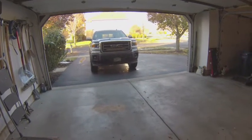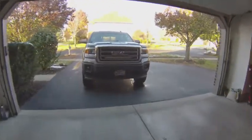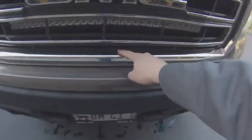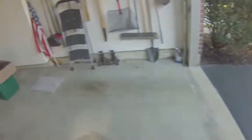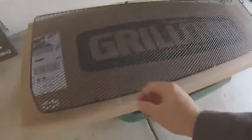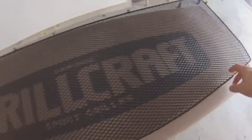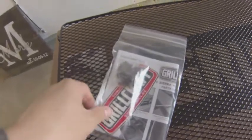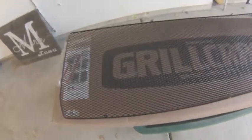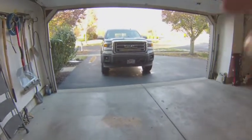So what we're going to do is cut out this center section using my Roto-Zip, running it all the way around the grill. Then this center section will just pop right out, and the mesh grill takes its place — pushed in from the front. There are mounting tabs all along the sides, seven tabs total, and it uses self-tapping metal screws and some small bolts. This also requires you to drill holes along the inside edge of the OEM surround.